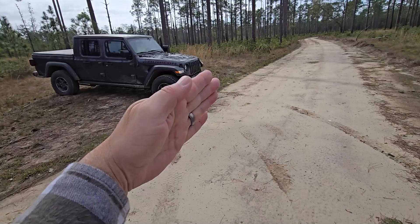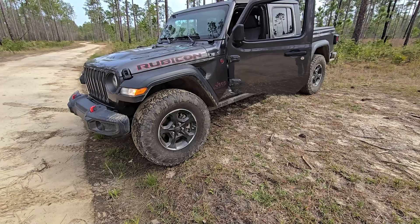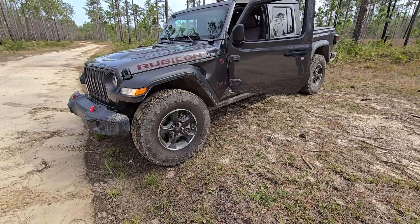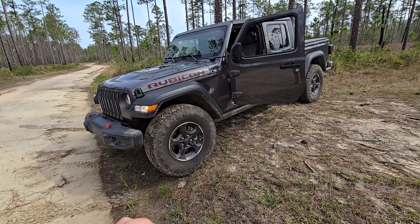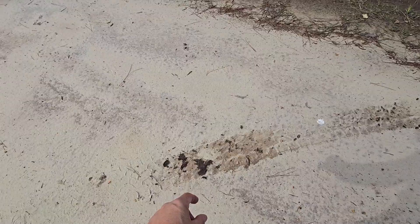That effect isn't hurting anything, but you'll notice it — it takes a little wider turn because the wheel is slipping and sliding. That's the reason we don't want to be doing hard turns on hard pack when we're driving in four high, like on pavement. On pavement you can't get that slide — it's just going to bind hard, and it's harder on your tires and your driveline. On soft ground like this, it's a cakewalk — no big deal.